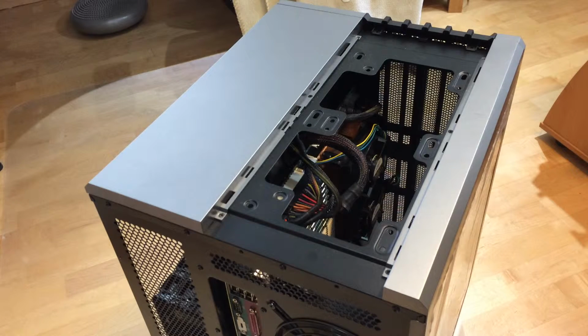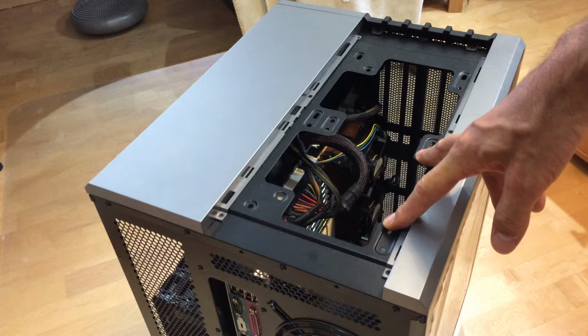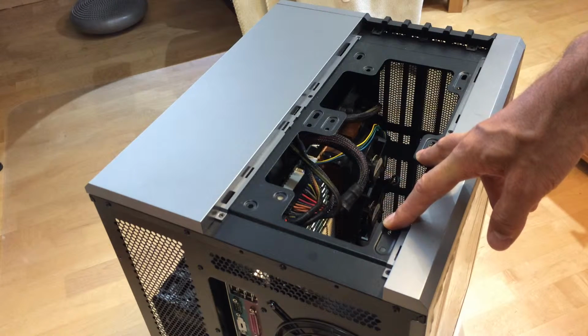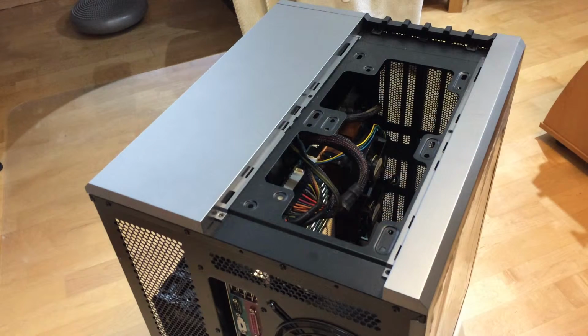It looks much more compact because although this motherboard has tiny little fans and tiny little heat sinks, with a modern processor you have this ginormous heatsink and ginormous fan, and it just dominates the whole motherboard and case space area. So that's the 2016 way to do it. This can support 140mm, i.e. slower spinning and more silent coolers. So I think this is a really excellent design from that point of view.